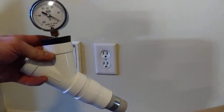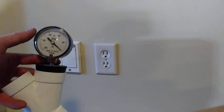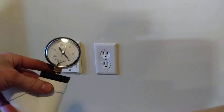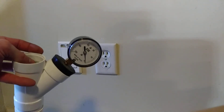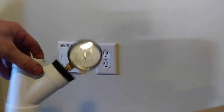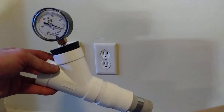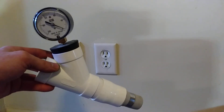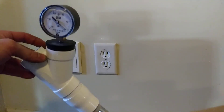This tool can also be used at the hose end. Typically your working vacuum will be 10 to 20 inches lower at the hose end than at the wall inlet, because the hose is the greatest restriction in the system. Your sealed vacuum should be pretty close to what it is at the wall inlet. I highly recommend having one of these if you service built-in vacuums. I even record the measurements on the customer's invoice so I can go back and see what it's supposed to be.